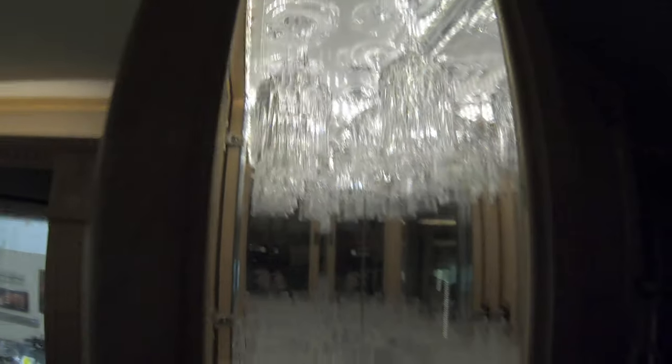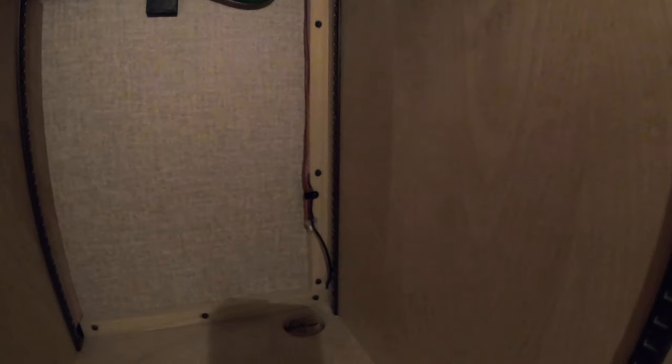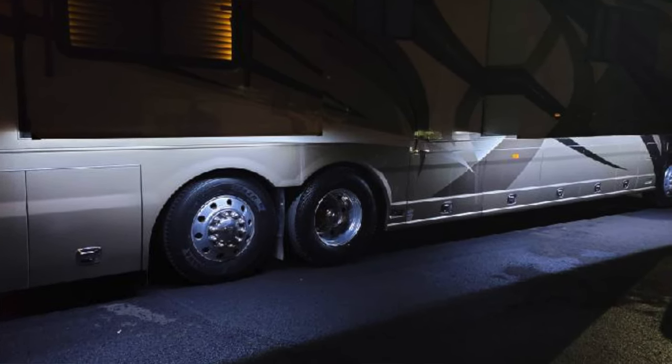Over the top is done — the cabinet has all the LED lights in there and the crystal. Then all these window boxes. Here where I ran my wires out of the end of this passenger side forward slide room, that's in this corner — got some 3/16 R-clamps, and I've got that service loop R-clamped up in the very back corner. I grabbed the ground off of the light there, then ran that power over to the output module under the sink.